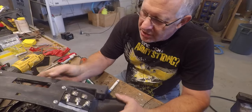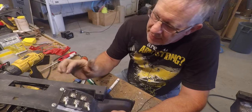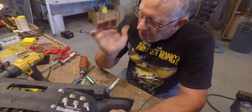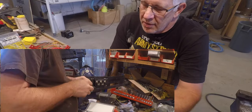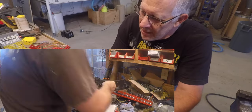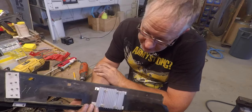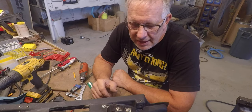This is pretty much the end of this phase of the project. This is the top of the fan shroud for the F-350. I've cut a hole into it and it has a section that grips on here and runs into the radiator. This is the front of the truck; this is the rear. The three phases from the alternator will feed into the diode bridge here, and positive and negative will come out here — inside the flow channel of the radiator fan, which is directly behind this. So this should get pretty decent airflow whenever the truck is running.